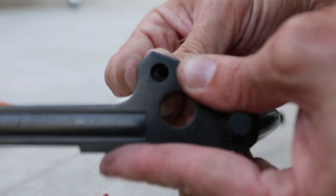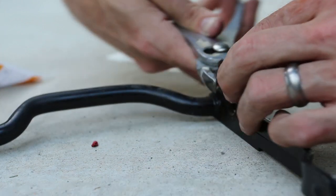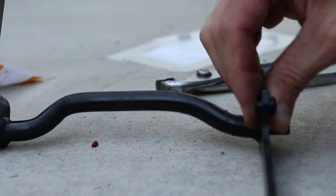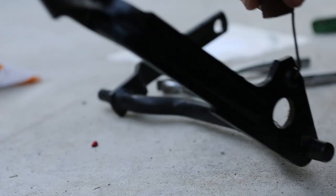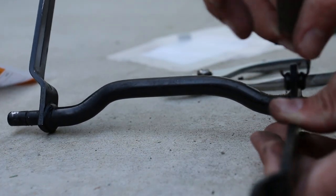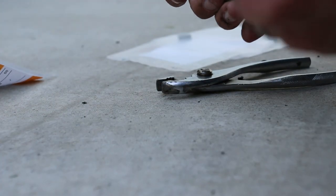Just using some pliers, I had to maneuver my body really weird and then I was able to just squeeze down on that and get it in - that worked out great. I'm going to put this little black grommet into this little hole right here. You may have to use some pliers to squeeze it down in there - just using a little squeeze technique, kind of squeeze it down in and past that little nipple part. There it is right there. That is that grommet. So you're actually going to put the spring in, and then that first bushing I replaced goes like this - now we have a nice spot to pull on with a freer flowing pathway.